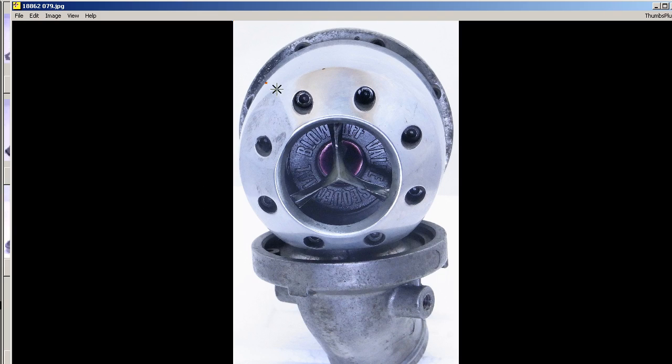And from the front there, we can see the little window through to the pink or purple colored little valve. This is the valve that moves back and forth sequentially, pulled on by the diaphragm there, and allows the boost to squeeze around the edge here, creating that very distinctive HKS Super Sequential blow-off valve flutter. So the Japanese HKS Super Sequential blow-off valve, made in Japan, from Japan.